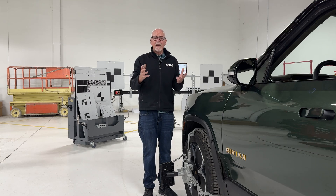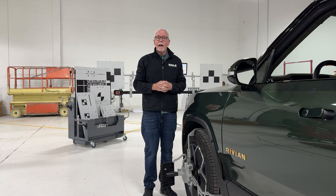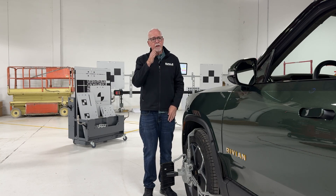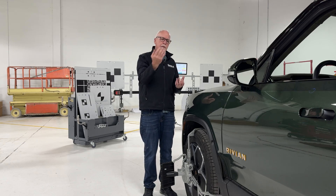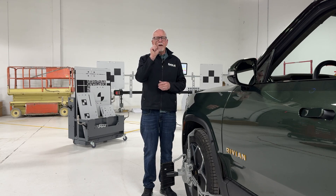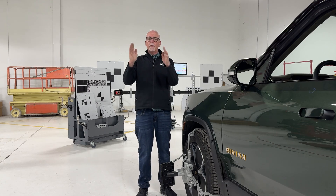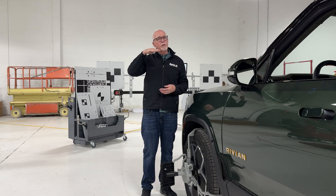One of the first things that has to happen on a vehicle is to understand whether the wheel alignment is right. Why is wheel alignment important? The camera system believes the vehicle is headed perfectly straight down the street. There's a thing in wheel alignment called thrust angle — essentially the difference between the plane of the rear axle and the front wheels. You may have seen this on older vehicles and pickup trucks: have you ever followed a pickup truck and could see all four wheels? They call that dog tracking — the alignment is out and the vehicle, although going straight down the highway, is not pointed straight.